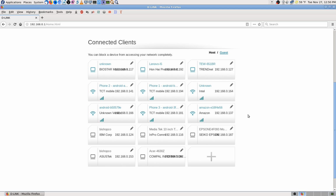And this is one of the reasons I bought it, though, I like it. It works really well. And one of the reasons I bought it, though, is because you can put DD-WRT or OpenWrt on it. I know there's a DD-WRT image for it, a bin file, because I downloaded that. But of course, I'd have to be in a situation where I'm not depending on it to do that. And I kind of like to wait till the warranty's out on stuff before I do that too. But I don't know. I looked the other day and they don't have any. They haven't given me an update since I bought it, so I may go ahead and do that because at least then I can manually update the firmware, for more security.